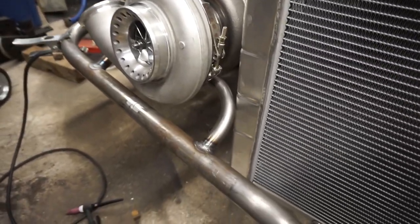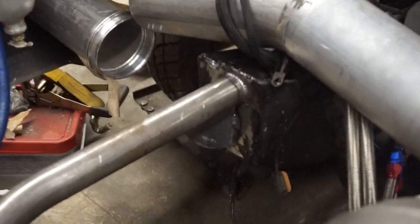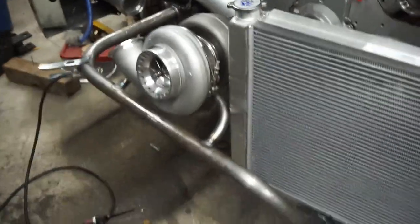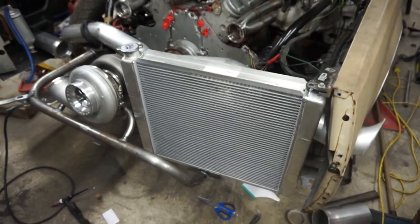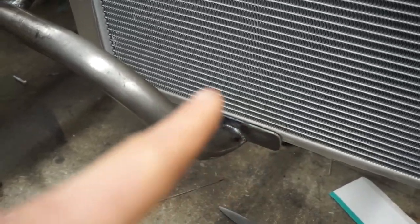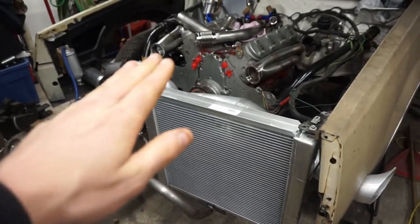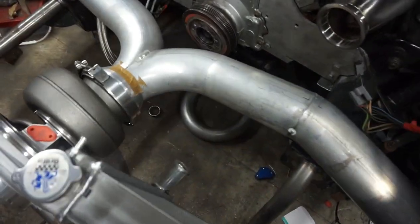So I got the turbo — it's all fully welded onto the rad support now. I even went around the rad support; it's all fully welded. I made gussets and everything underneath as well, just to help with it because it does have a lot of weight out here now with that big heavy turbo and the rads. Just extra strength — make it last a little bit longer. This is where the rad is going to be. I just made a quick little pedestal for it to sit on and then I'll put bolts through the bottom of it. I'll have to build mounts off at the top as well, but at least it is where it's going to be and I can start building the merge pipe down to the turbo.